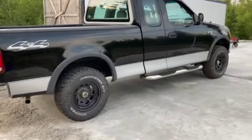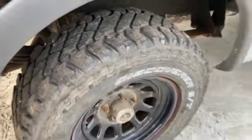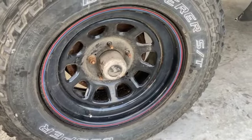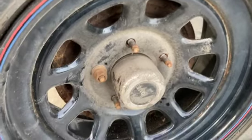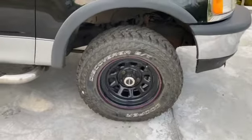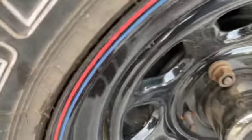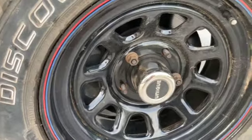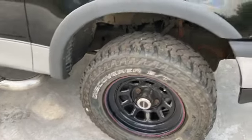There's a new set of tires — new used — but that's some of the things you got to do to increase the value. Really good set of meaty tires. I need to get some lug nuts and clean up the wheels. These lug nuts are what they call flange style — I don't have them tight right at the moment. I need to go get some acorn style. I just wanted to get them on there to make sure they work. We're going to have to put wheel spacers behind these wheels because they are just a little too close to the caliper for comfort — we'll put a quarter inch wheel spacer in there just to make sure we've got a little extra room.